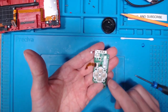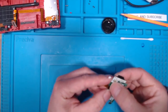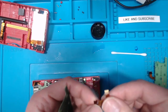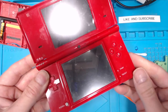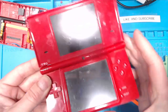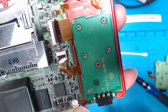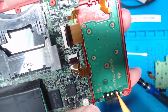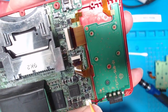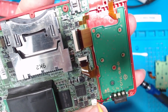I've had this problem before and all I did was give it a good clean with alcohol. This is the original ribbon cable so that could still be a problem. This is the original daughter board after a clean and we've still got no power. I've checked the positive terminal on the battery — continuity does go through to the positive wire on the connector, and the negative too, so it's not the cable.